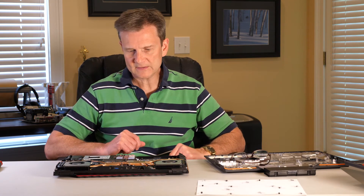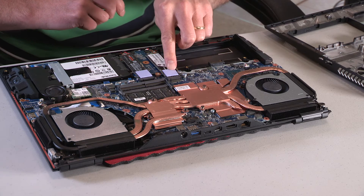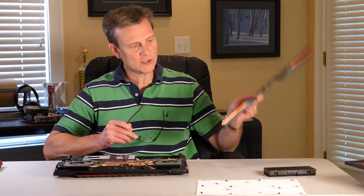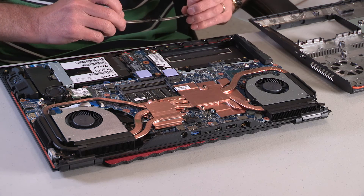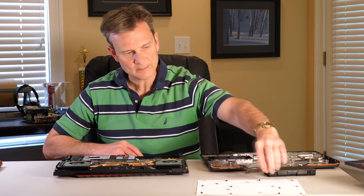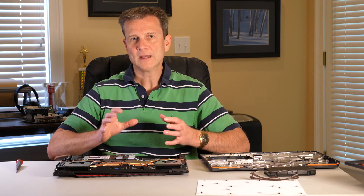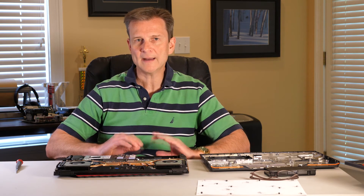One thing to add: there is a thermal pad on the original drive, designed to take heat out of the drive and keep it cool by transferring heat into the metal casing on the inside of the laptop, which helps disperse the heat. There is an extra thermal pad included with the laptop, and you should stick that onto any new NVMe drive that you install. That's the installation procedure — it's simple, anybody with one small screwdriver can do it. Now I'll get this cover put back on and then show you how to make Windows recognize the two drives.